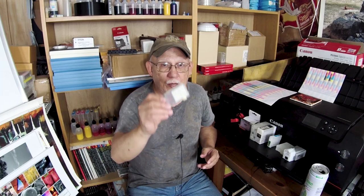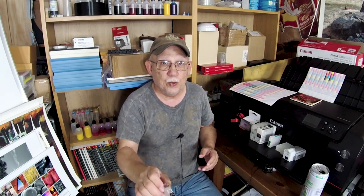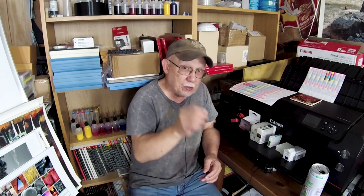The chips are color coded. Remember that each chip is color coded to a specific color — they are not universal. So be aware of that; you cannot mix and match. These cartridges are not keyed, so you can mistakenly put them in the wrong slot, although it is pretty clear. Yellow goes in the yellow slot, not the magenta slot. If you do that, you'll get an error and a possible lockup of your printer. Chips are individual, they are not universal, and they cannot be used from printer to printer — say different models that use the same cartridge. You need a chip for that specific color and that specific printer model.